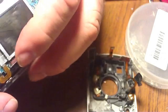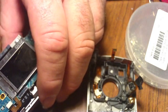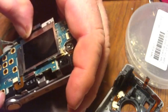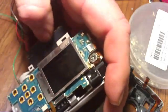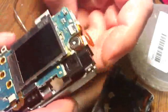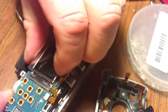I think I might be able to just replace the LCD. We need to move the LCD holder — there are two little catches. Push down on it and we can pop the card reader down. I can put my finger underneath that clip and pull the LCD out. There are two clips on each side, and you push the LCD over to remove it.